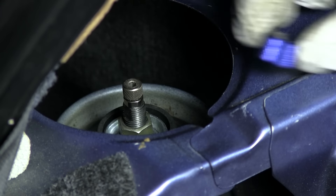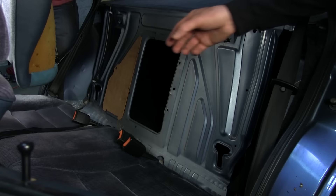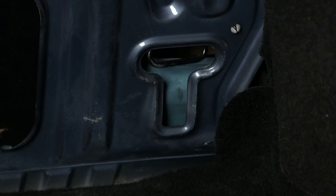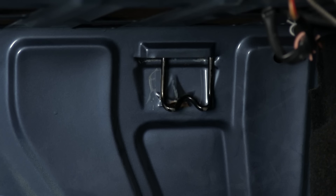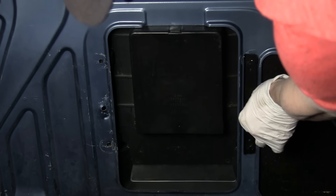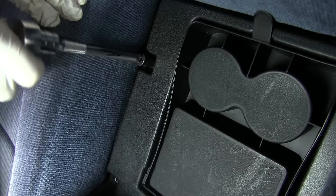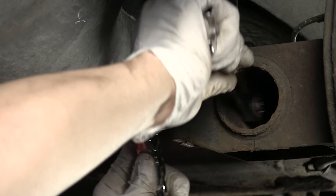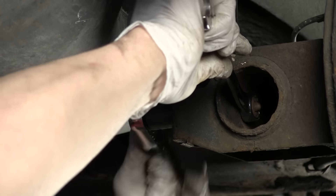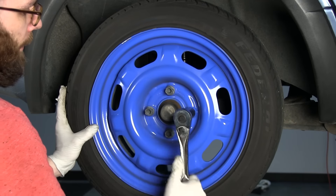If you're installing the Primo kit, you can now press the damper's adjustment knob onto the shock. Slide the seat back into position, taking caution to make sure the seat back clips slide into their proper positions. Place the center armrest brackets into place and tighten the four nuts holding the center armrest into place. Reinstall the nut and bolt holding the coilover to the hub of the vehicle. You can now reinstall the rear wheel and the installation for this corner is complete.